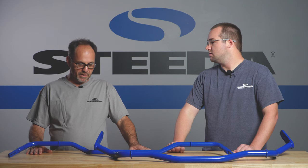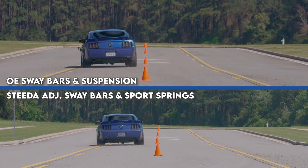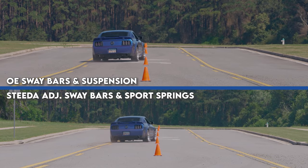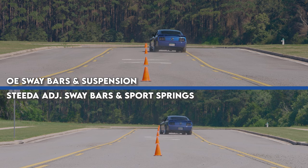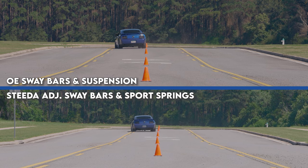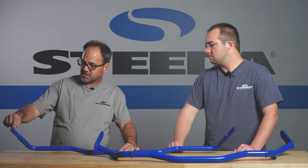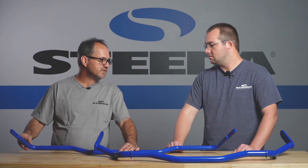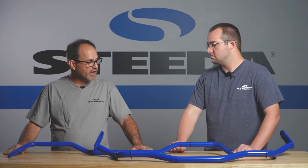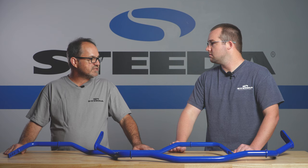It's not going to ride like a buckboard because you increase your spring rates. And having it adjustable means that you can tune it to what you are doing with the car. If you're going to go to a weekend autocross and you'd like a little bit more control over the body roll, you can increase your roll stiffness on the bar with the adjusters. The furthest hole will be your softest setting, and as you go in shortening this arm, you're increasing the stiffness of the bar. You can make adjustments and find someplace where your car is happy and you can feel comfortable with it.